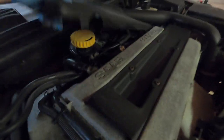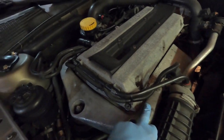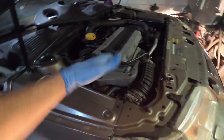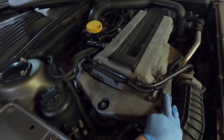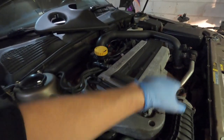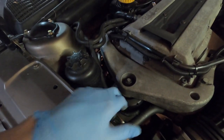So let's go ahead and remove this engine mount bracket — four 16-millimeter bolts and an 18-millimeter on the center. Make sure that when you're replacing and reinstalling this, you have the engine properly lifted up with the jack. I'm going to put a block of wood in between so you don't strip out these holes. I've done it before and had to re-tap, and it is aluminum, so be careful that you don't use the bolt to lift the engine weight.